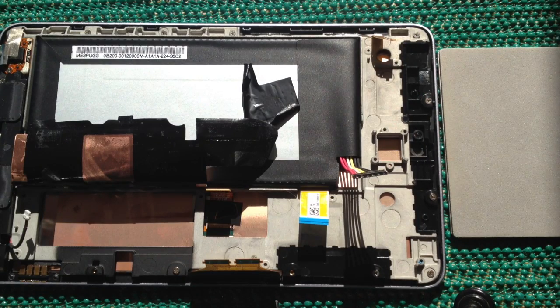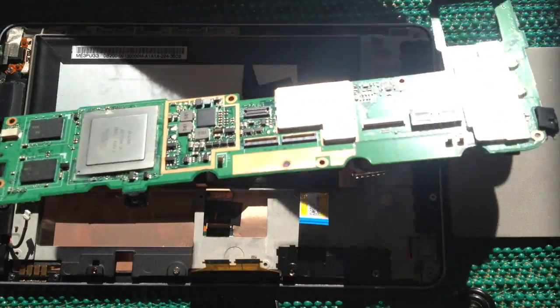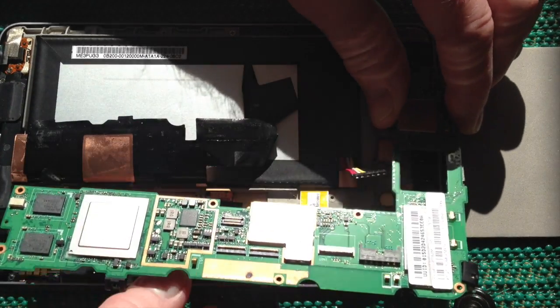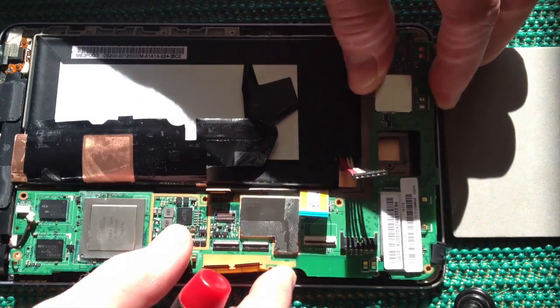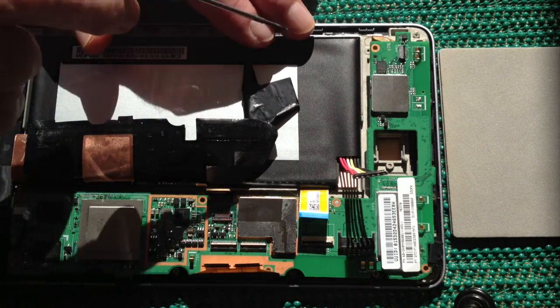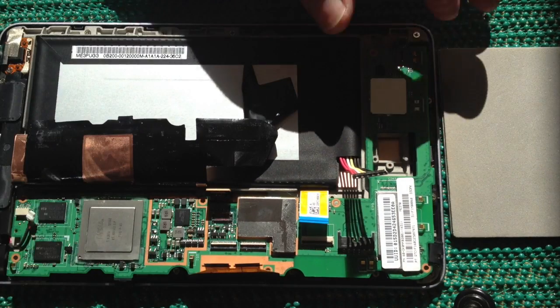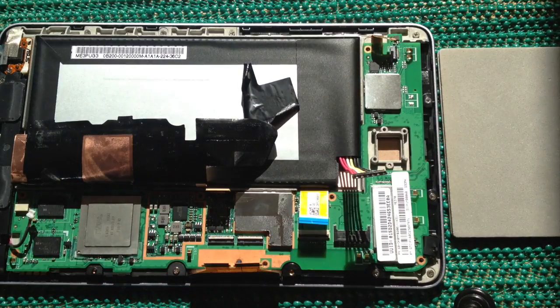To replace the motherboard with a working motherboard, what you do is work in the opposite direction. The main thing is to align it so that the motherboard sits underneath all the cables and get them in place. Be careful not to lock any cables underneath, then gently maneuver the board back in place and fit all of the screws.